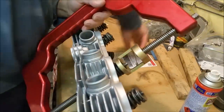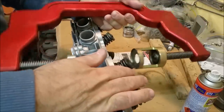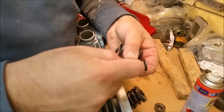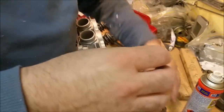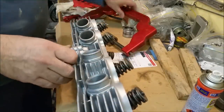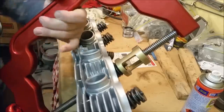I'm a bit of a dick — I'll show you why. I put the springs in the wrong way around. I didn't realize until I pulled one of the springs and retainers out of the bag. I put these upside down — that painted bit has to face up. If you look at the inner spring, the coils are tighter at one end, so that's the wrong way. I've got to go around to all of them — different spring rate — so I've done these too; I'm doing them all.